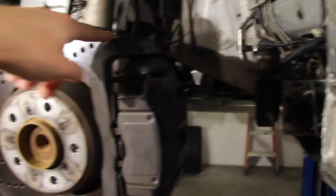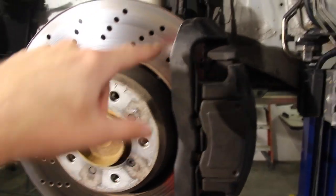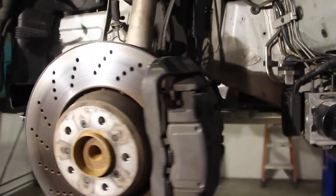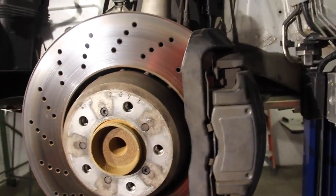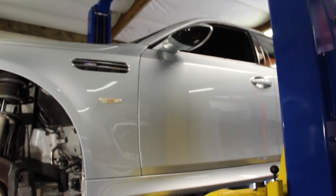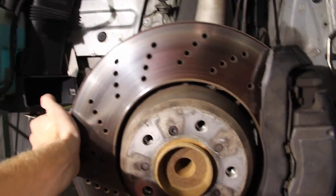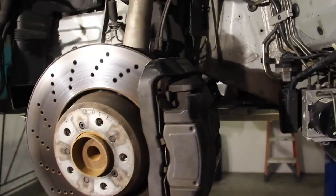We need to take the caliper off the carrier. The carrier is the part that's going to stay when the caliper comes off. Since we're going to be doing rotors, we're going to be taking the carrier off as well, which is secured to the back with two 16, 17, or 18 millimeter bolts, and then the rotor pulls right off. It's really straightforward - pretty much the same as a brake job on any other BMW. It's going to help to have the key with you. Press the button so everything lights up but don't start it, and then you'll be able to turn the steering wheel to give you better access to the bolts holding the carrier on.